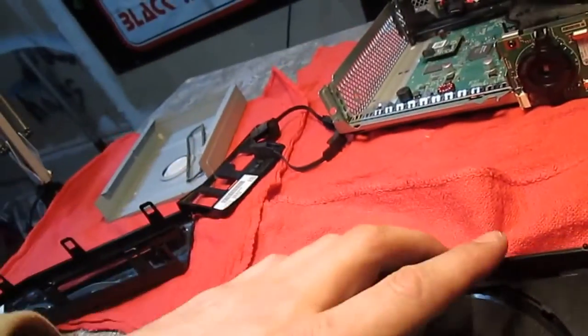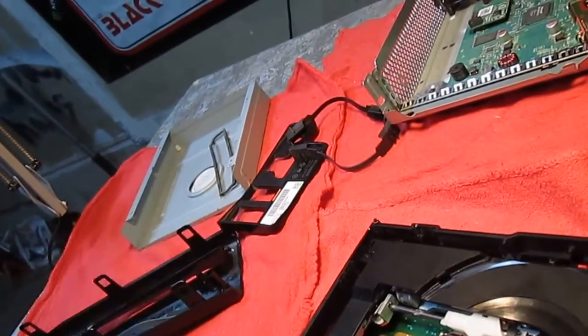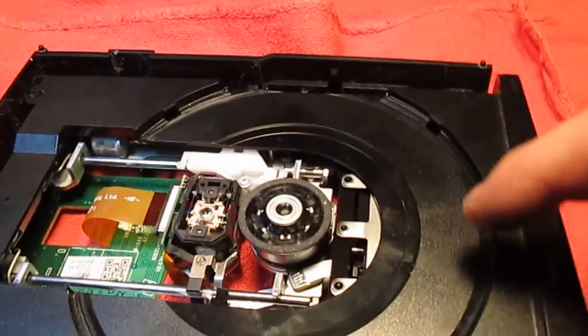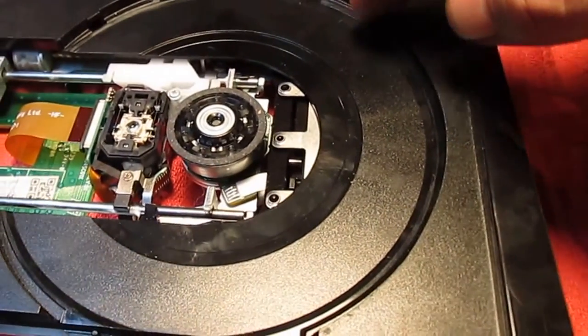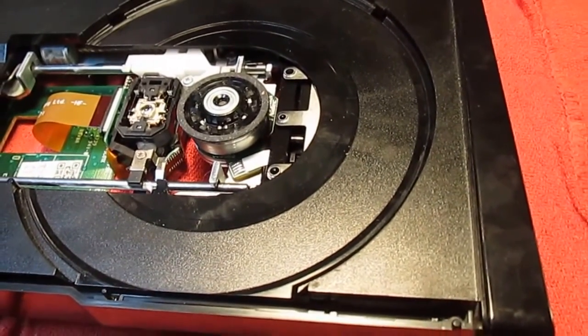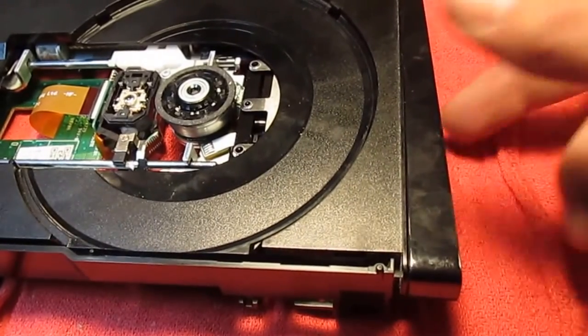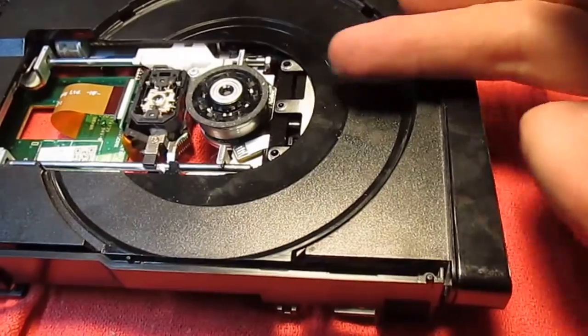Okay, well, my battery died. I had to charge my camera up, and in the meantime, I put this back together. I do apologize, but there's a wheel here and a wheel here. When you slide this tray out, you turn the wheels counterclockwise, so when the tray is fully extended, it knows it's in its true position to be extracted. And then you can just slide the tray back into place. Now we can start assembling it again.